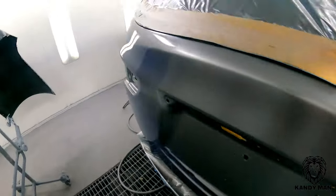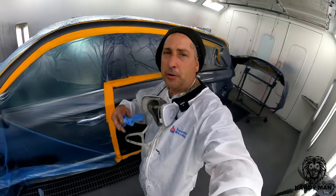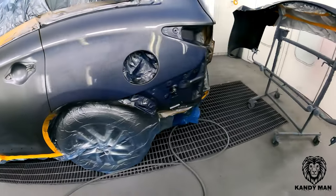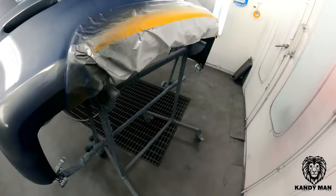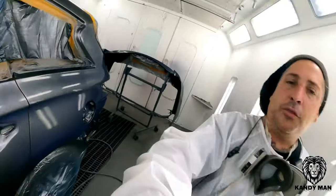If you do the same steps and get a little better at them every time, you can definitely speed up, perfect them, and move through jobs quicker. That's how I do it. We're going to let this one set up, come in with the control coats, and then clear it. We're going to clear this one with the clear coat gun — that's my quick in-and-out gun right now. The booth is running at about 105 degrees without the heat on, so we're going to move through this one quick, finish it up, and check it out.